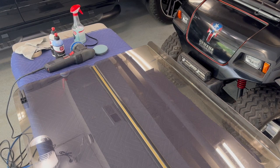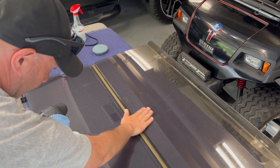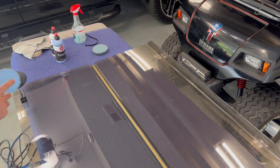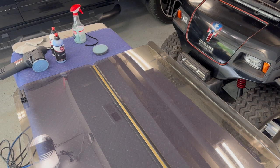Quick update: I had it pretty much polished up and I thought we were done, then on re-inspection I found some more hairline scratches. So I went after it with a different pad which cuts a little bit heavier than the foam pad. I've been working that for a few minutes and I see a couple more. Just keep working it — to get the best results you might have to make a few attempts. You put it up, it looks good, and then you find little ones here and there. But we're going to clean it up as best we can. I'm pretty satisfied so far, but I'll take it a little bit further.